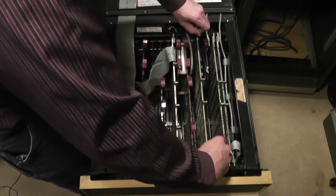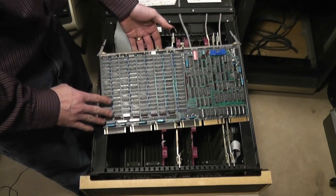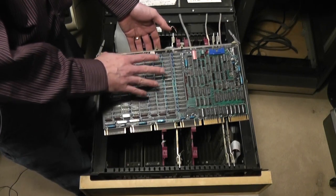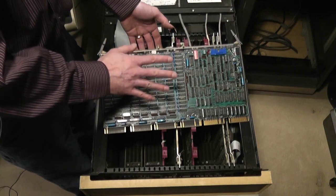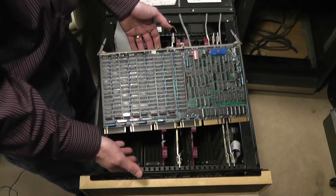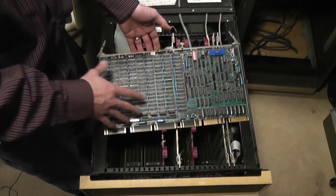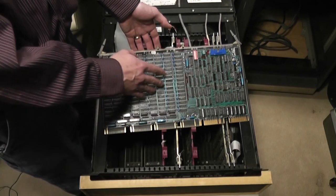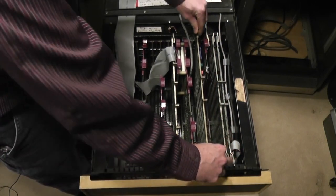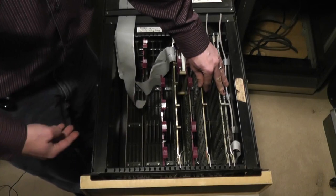After that we have a RAM board — this is the only MOS device in this system, at least to my knowledge. These are MOS RAM devices; everything else is TTL — transistor-transistor logic — versus metal oxide semiconductor logic on this RAM board. This is an MS11LD, the largest RAM board made by Digital for this type of machine, and it populates the entire memory of this system. It has a quarter megabyte of RAM on it — plus parity — and in fact this system can only use 248K of this 256K of RAM. By placing this in one slot, I'm populating this machine with as much RAM as the CPU can possibly address.